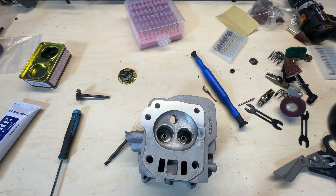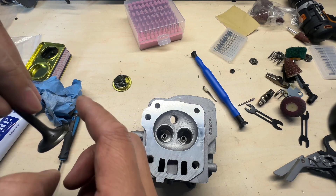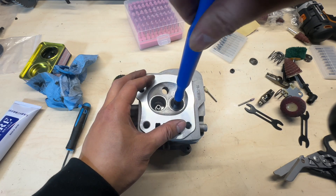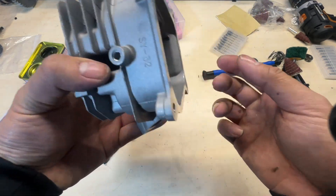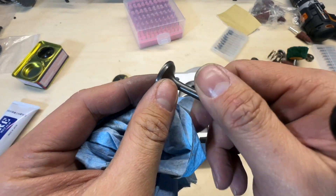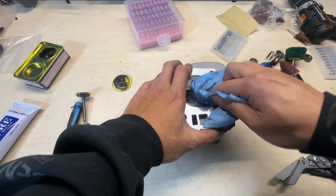You can see there's like a band — that's basically the mating surface. That's matching, which is great. Next we need to do the exhaust. After we do this we definitely need to do a leakage test just to make sure it doesn't leak. You can see there's no band here before grinding, but after we do the grinding there should be one. There it is — the band. Valve matching is done.